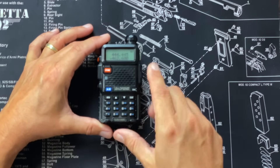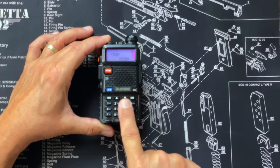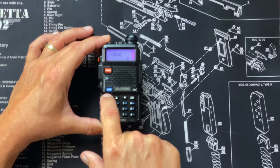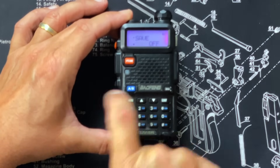To turn the battery save off, go to menu — it's already on menu item three, but if it wasn't I'd use the up and down arrow button. Hit menu again to select that menu option, go to off, and hit menu again to confirm.